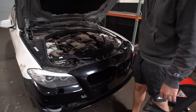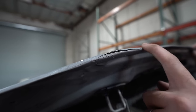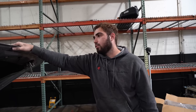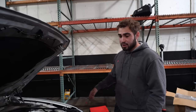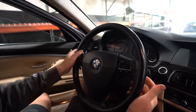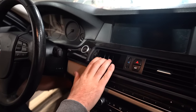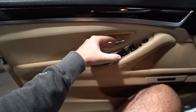Alright guys, so we got the bumper on there — it's not absolutely perfect just yet, but it doesn't matter because once we get everything painted we're gonna start reassembling everything. The hood we picked up from the donor car had a bondo crack but it was the most reasonable hood for a car like this — all the other hoods cost almost as much as we paid for the car. For the interior, a couple things to knock out: the clock spring — the ribbon is snapped, making weird sounds — so we need to take off the airbag and steering wheel to replace it. Also fixing the broken air vent and replacing this very sticky door panel section. Three new parts — let's get to it.